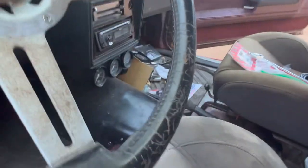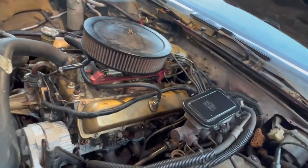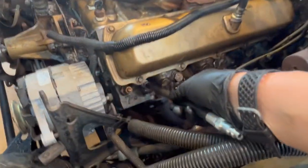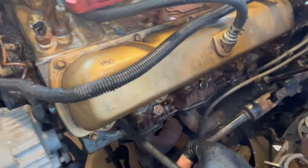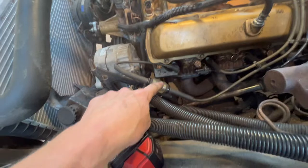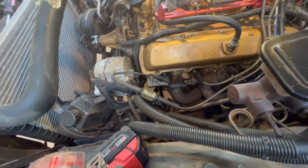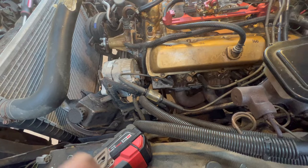Clearing the cylinders also lets us look at some oil pressure — we've got 40 PSI. I'm going to hook up the compression tester on a few cylinders just for giggles and see what we have. We still have our markings from the last time. I swapped valve covers because the PCV valve was on the wrong side. Let me play around with that, check compression, and then go from there. We've got our spark tester ready to see if it's firing — the distributor could also be out of time since it isn't set yet.